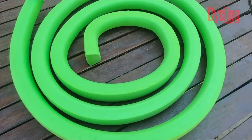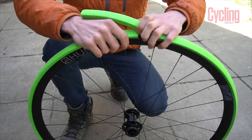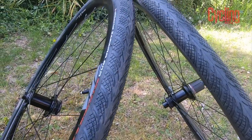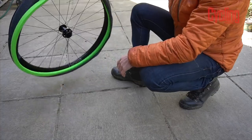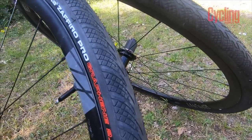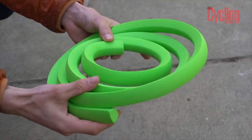For the promise of effective immunity from punctures, I think it's a fair trade. But at around £65 for a set of two road liners and around £70 for the gravel liners, they're essentially the price of a fresh new set of tyres — and particularly if they have to be replaced after one hour of riding them flat, it's a lot more expensive than just using an inner tube. The value really comes down to how expensive your wheels are. If your rims are just £30 a pop, there might not be much point. But if you've spent a lot on expensive carbon rims, it's probably sensible to protect them. I'll set these up in an all-road guise with 32mm tyres and fairly minimal tread, which I think complements the qualities of the inserts. On rough off-road sections I get the protection a larger tyre would offer, but on the road I get the lower rolling resistance of a 32mm tyre. It could be the best of both worlds.